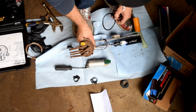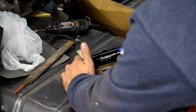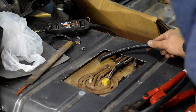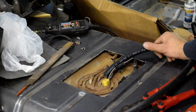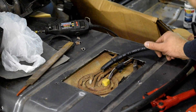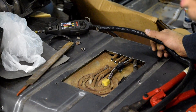We got these lines cut and cleaned. Now we just gotta drop in our new assembly. Don't forget your O-ring. Now we have a tube line — let's cut the right length and use some clamps to keep it in place. The tube lines are bigger than the other ones; I'm using 3/8 for the outside ones. The feed line closest to the wires is the main feed line. I'm not sure which of these is the return — I think the far outside is a vent, the next one is the charcoal canister, and this one is the return. Use the proper size lines, clamp them down, and we'll check our pressure.